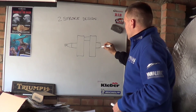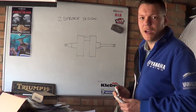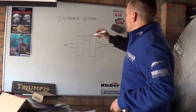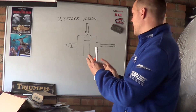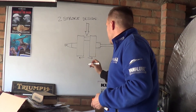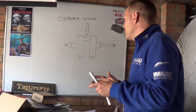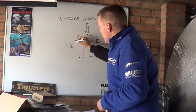You'll then have your other journal like so, and if you're doing it on a moped or something it has a shaft like that for your variator to go on, with a thread and splines and so on. So why do we stick our bearings here and why can't we do a switcheroo? Well, the reason is because of the loading that happens with this engine — when you fire your piston you are putting a lot of load, a lot of force on the top of the actual crank pin. This causes the whole crankshaft to flex, and it flexes out this way, so these two webs basically bow out. This happens in microns, but it does happen. To increase the stability and rigidity of this system, you put your bearings here as close to each other as you possibly can.